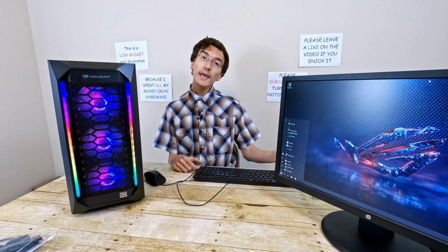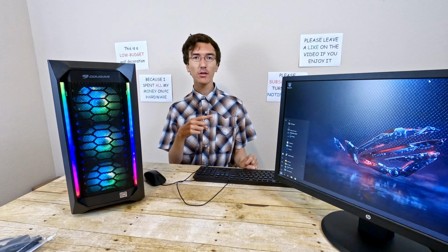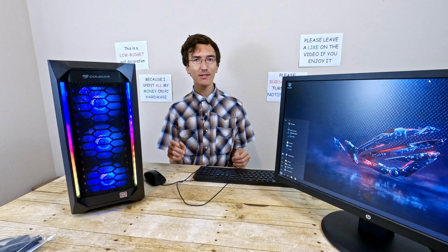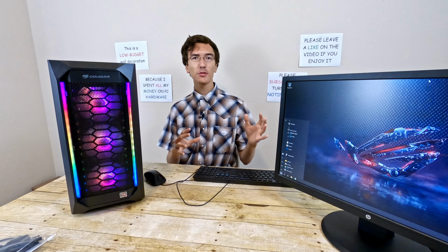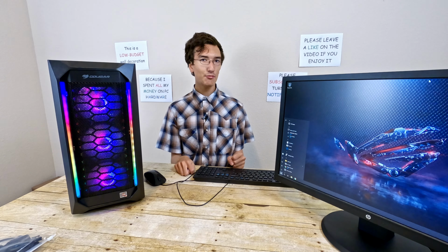So finally I reinstalled Windows again, and I made sure that Windows could not connect to the internet until I manually installed the Nvidia display driver. And once I did that, I was able to get all the updates and get everything working, and I did Cinebench and FurMark simultaneous runs to stress test this to make sure it can handle full load. Windows, you really got on my nerves, Windows.